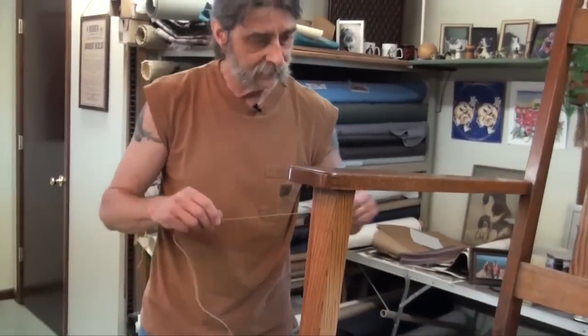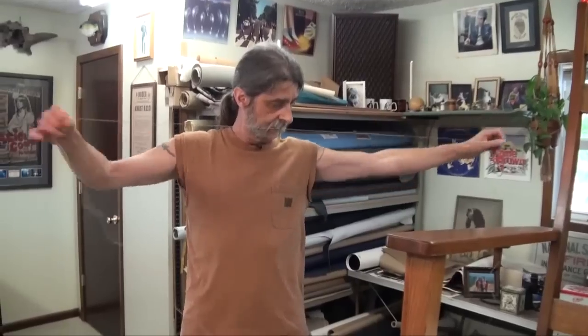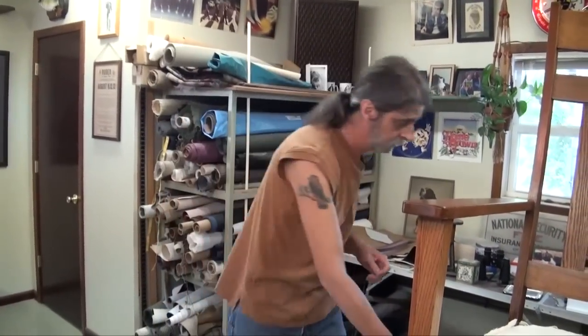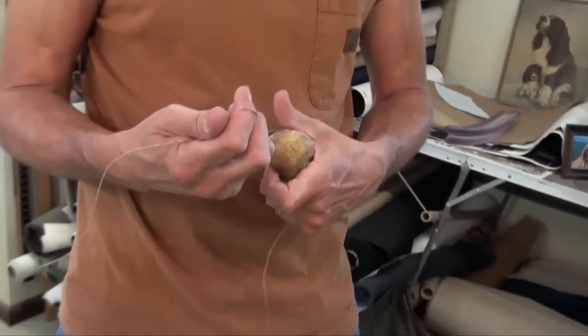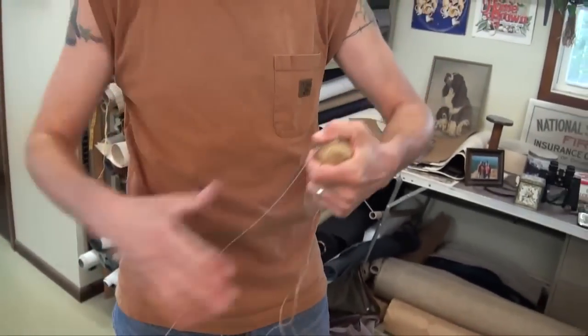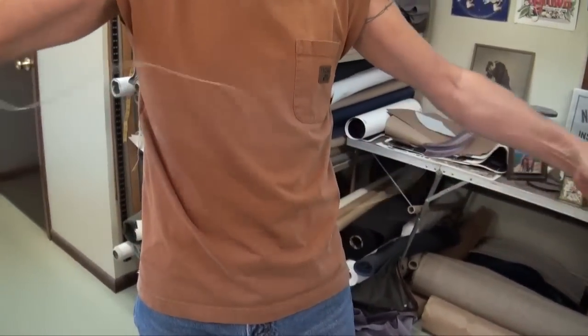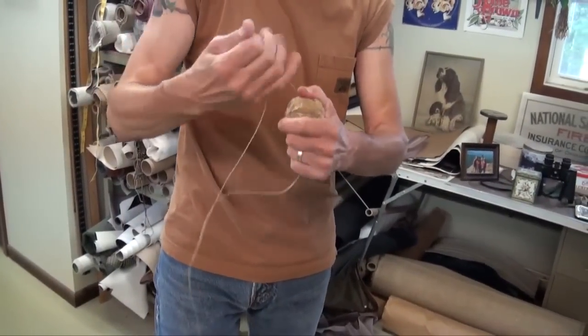Okay, I'll start the stuffing process for the seat by pulling off two or three wingspans of string here. It's best to have plenty. This is some Italian hemp, just like the spring tying cord. Well, it's just more of a lighter string. I'm running this through a beeswax ball. It makes the string easier to work with, and knots tend to stay in place better, and it helps take a lot of that memory and kinking out of the string too. That's one of the most beneficial things.